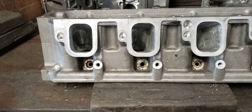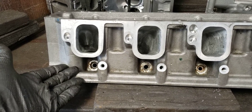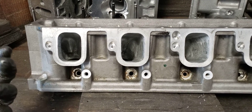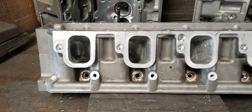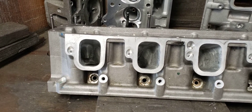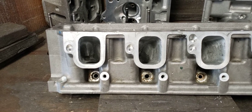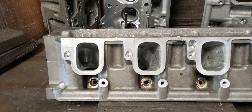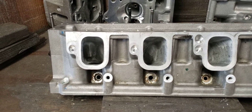We have to think backwards when we're talking about cylinder heads or any airflow — all the way from the cold air filter through the intake track, through the intake manifold, to the cylinder head, to the intake valve. On a naturally aspirated setup, it's only what the piston draws that you get into the motor. We're not cramming anything into the cylinder — we're using piston stroke, overlap with the cam, and a couple other techniques to create as much volumetric efficiency as we can. We need to make sure everything in front of the intake port is well-sized for the motor application.